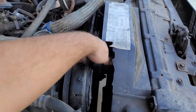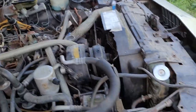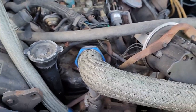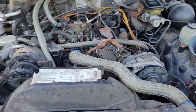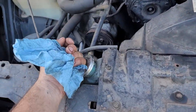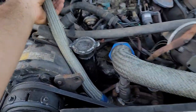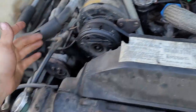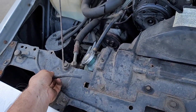I got a fan clutch, so hopefully when we get all the cooling stuff we'll get that put in and the cooling system will be sorted. I'm probably going to have to do coolant temp sensors too. I was thinking maybe the ECM fuse being bad caused the temp gauge not to come on. Even so, the radiator cap's not very hot, but the hoses are frickin' hot — for less than 10 minutes of idle time they're well over 100 degrees, but the radiator cap is lukewarm. So I think maybe the thermostat's sticking. We've got a thermostat on the way too.